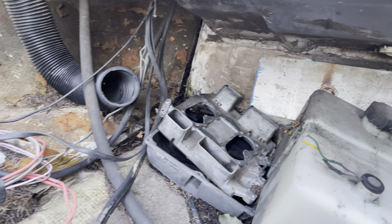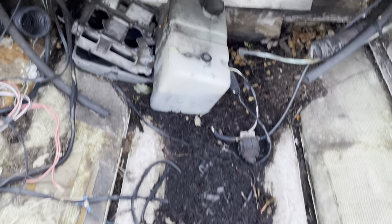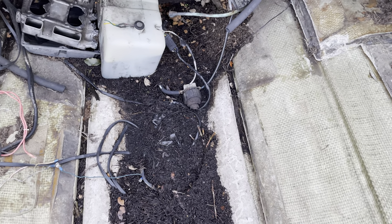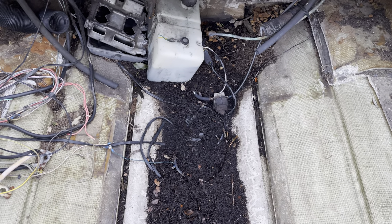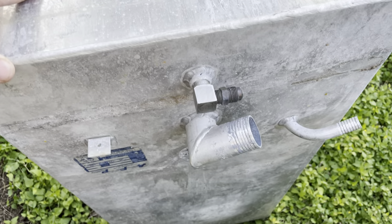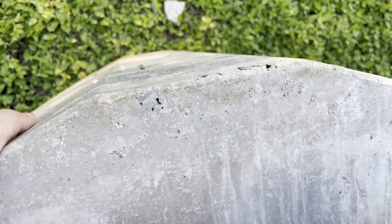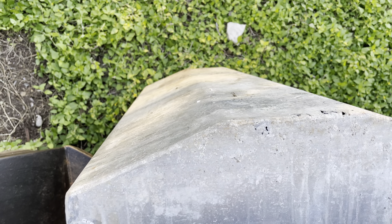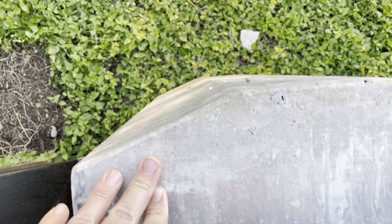One of the other things I wanted to show you is the effect of varnish on the fuel tank that was in here. It was pretty bad — we actually tried to clean and salvage it but the fuel tank is definitely not salvageable. Take a look here with it tilted on its side — see those holes? What I ended up doing was putting a little bit of acid, 50/50, got it from Home Depot, nothing crazy. My goal was to try to clean the varnish out, but you can see it ate holes right through, and it's like that all the way down.